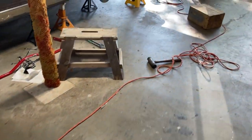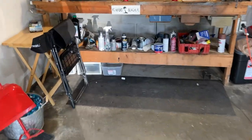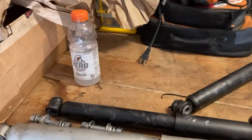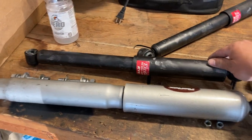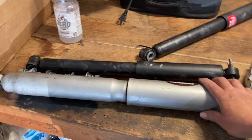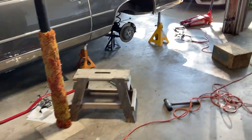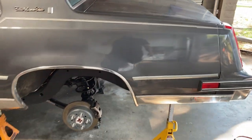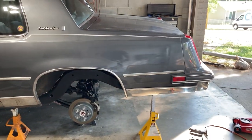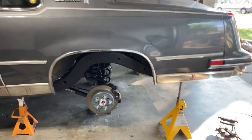The company will say you don't need that because once you put the weight in the trunk it's gonna come back down to ride height and it'll be fine — but look at the difference. This shock is nothing in comparison. The longer S10 shock is going to give you a nice smooth factory ride with all that weight in the trunk. Anybody riding with a serious stereo like we do has about 500 pounds in the trunk between amps, the box, and a secondary battery — so that's what we came up with.